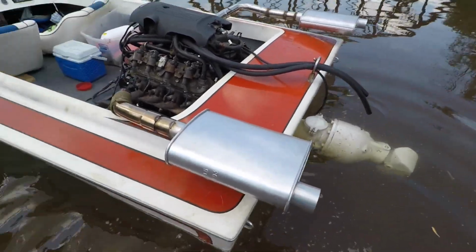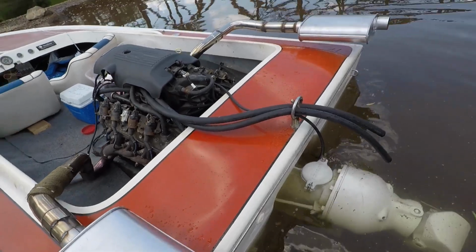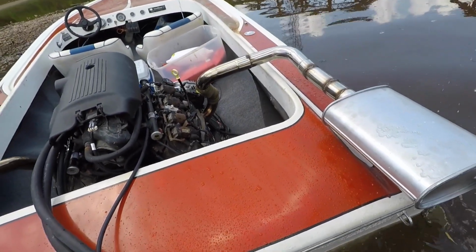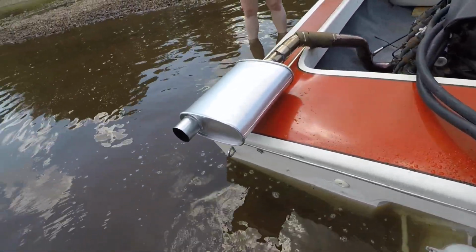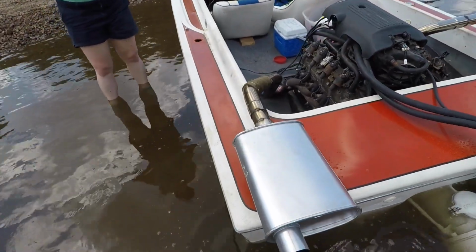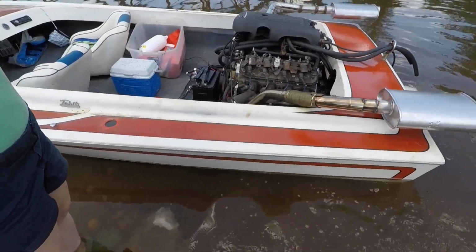Sweet. Let's see if this side boils. Ooh, that's hot. I'll check this side. Cool, I want to get some eggs. So we do have cylinders running on that side. It was steaming when we stopped. I guess we're going to have to get the temp gun and see which side is not working, because it's running a little rough. Maybe I can do a data log.